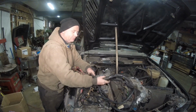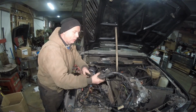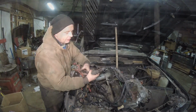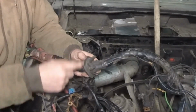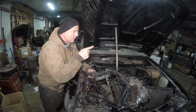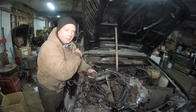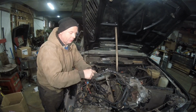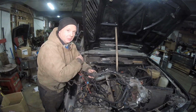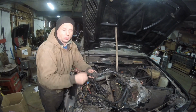What this does, though, is I use the original grommet that came in the 20 valve, and what it gives me is ports right here that I can run. Let's say I want to run the rear window washer fluid to the back and not have a reservoir back there, because that's probably what I'm going to do, use a double stage pump. I'll run it through here. I want vacuum lines to the back vacuum reservoir, so I can do the door locks and all that stuff.